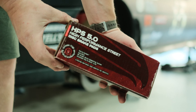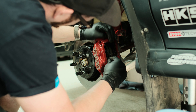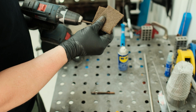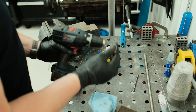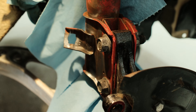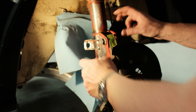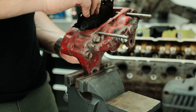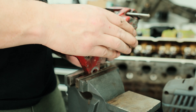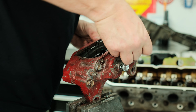The following day was the last full day to work on the car, and basically I was going to be focusing my attention on the braking system. Gave the front brakes a service with new pads, cleaned up the sliders and the pins, got everything lubed up nice and fresh. On the passenger side, however, I did have to remove the caliper and the rotor because the damage from the brake fluid leaking after we blew that line in California in the winter was pretty extensive. So I scuffed the entire bottom of the shock, hit it with some red caliper paint as it would take the same amount of abuse and sort of matched the KYB color, just to get it freshened up and protected. Then serviced the caliper on the bench, got the sliders cleaned up, got everything back in and ready to go. These calipers could use another powder coating, but I'll probably tackle that next year.